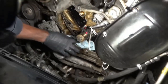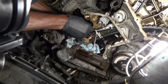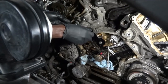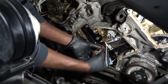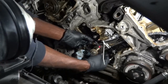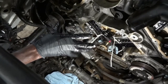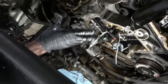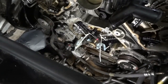I'm keeping this rag down here in case I drop a bolt — you don't want to drop a bolt down there. Now we're going to get our chain on the sprocket. I have installed the tensioner and we're going to torque all these bolts afterwards, so we just get them tight and snug now. We're going to double-check our marks — verify the marks on the cams and down at the crankshaft. If everything is lined up then I'm going to remove the release for the tensioners.